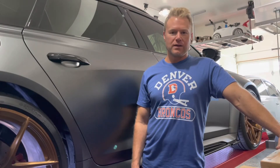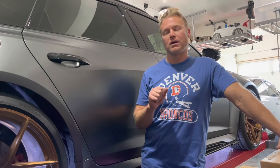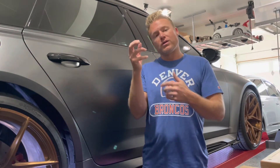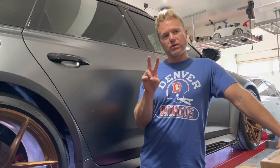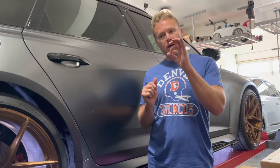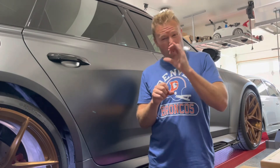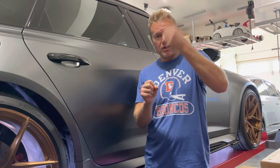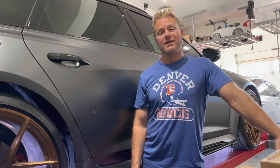That wraps up the disassembly. Two critical things: number one, removal of that upper B-pillar trim was the most critical part — be very careful, take it slowly, use the trim tools, and pull it back towards the rear of the car so you don't damage the aircon vent. Number two — it didn't show very well in the video — on the end going up towards the front seat there's a ring at the end of the belt that engages into the cable plug. Make sure you pull that cable out of its little home — that gives you access to the housing, which you can undo by sliding it about two millimeters and it'll pop out pretty easily. That's it guys, best of luck, go get them, thanks for watching.